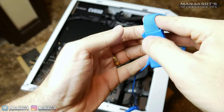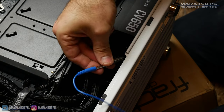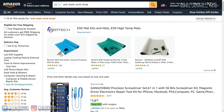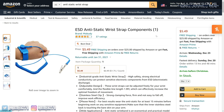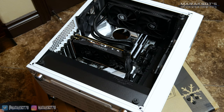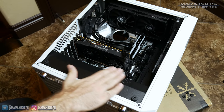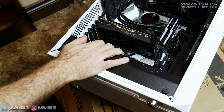There are some people out there that will tell you you should never touch anything in your computer unless you're wearing an anti-static wrist strap connected to a grounding rod or at the very least connected to your computer case. While these wrist straps aren't incredibly expensive and are readily available online, all you really need to do to equalize the static charge between you and your PC components is to touch a metal portion of your PC case. Just do this once every few minutes and you'll be just fine. I've used this technique while building every computer I've ever built, and in 15 years of PC building I've killed a grand total of zero PC components.